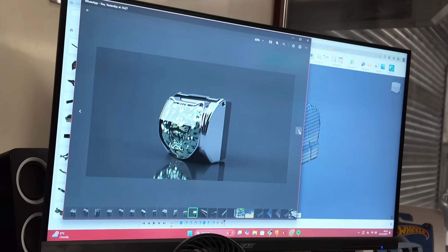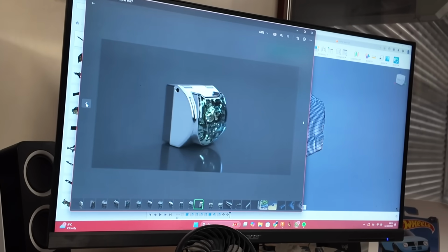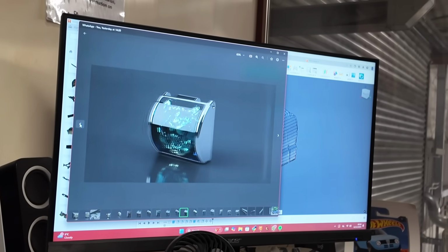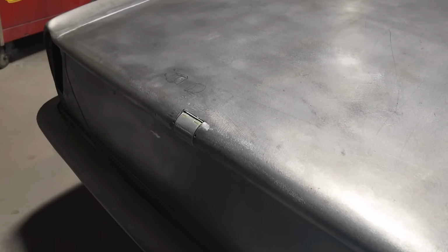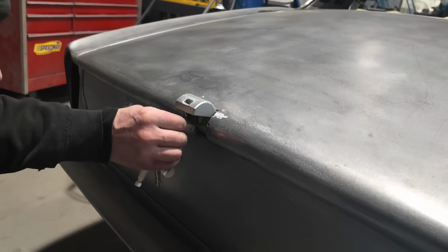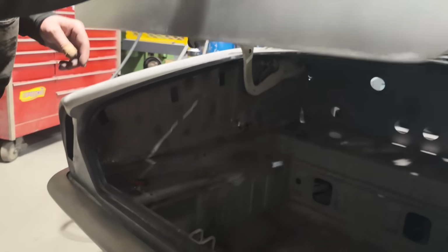So there's a big chunky chrome thing with the number plate lights. It's got a handle that you release the boot with a lock within it that stops it being able to turn. So we're cleaning all of that up. The number plate lights are going to be flushed in underneath the sort of sheet metal part of the boot lid that overhangs the plate. And then yeah, this little block, which is currently a 3D print, which is going to be a hinge section with a lock, and you just turn the lock to open the boot rather than having a separate handle and lock.